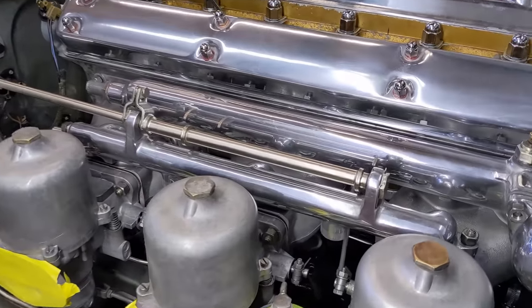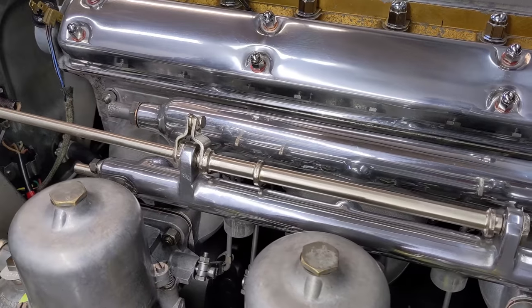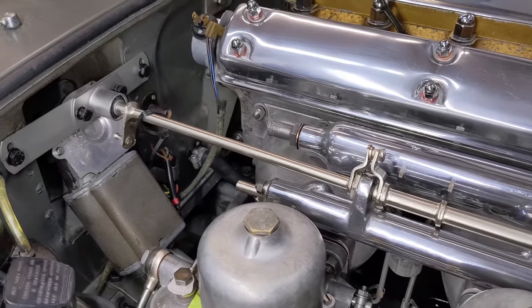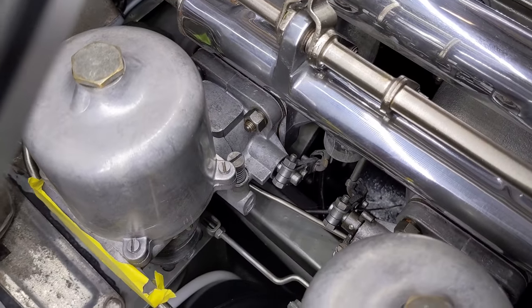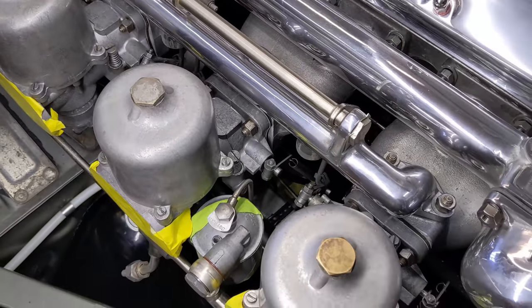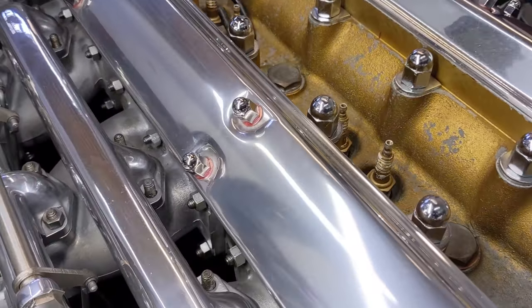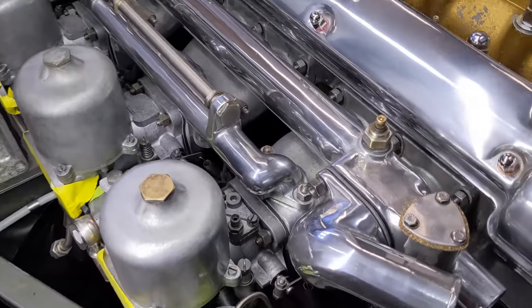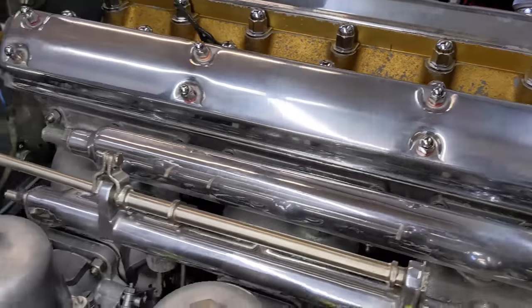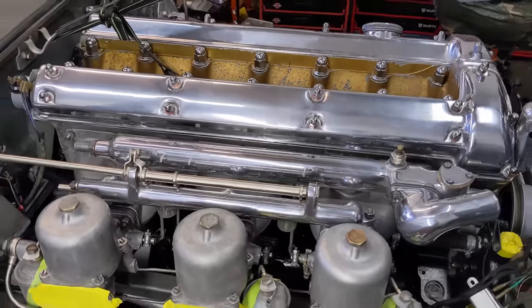There's another thing — plating. Some of the hardware here has been nickel plated. You see the accelerator linkage? I can tell it's been nickel plated because it has that beige look to it, which is really indicative of brass-era cars I see done at Pebble Beach. As with any restoration that ran out of money, there are always things left behind. One of them was this coolant tube — it's not attached, so I'm going to have to deal with that, put some gaskets in, seal it up with silicone. Looks like I need a thermostat here as well — there's nothing in there. This is the temperature sender. The spout at the end of the coolant tube needs to be buttoned up as well. Just a few things to get this intake system 100%, but it's coming together.